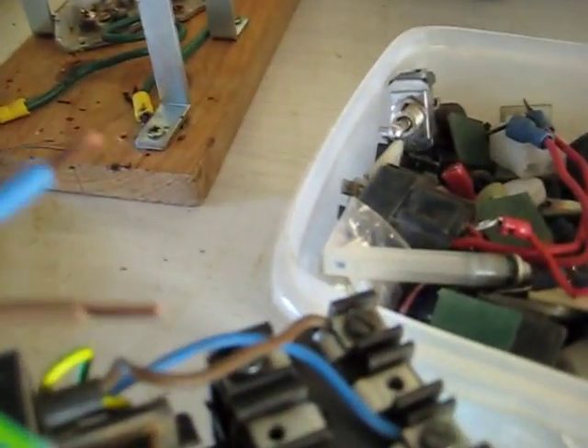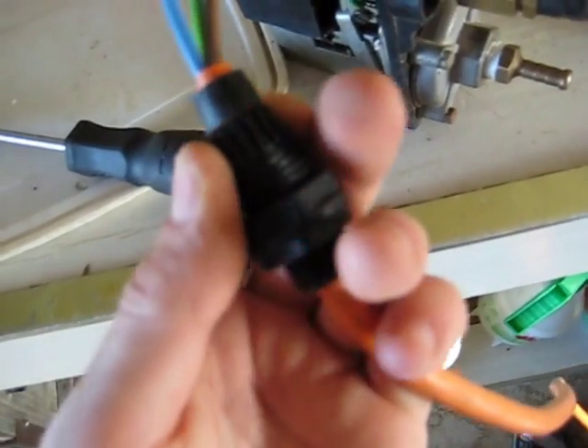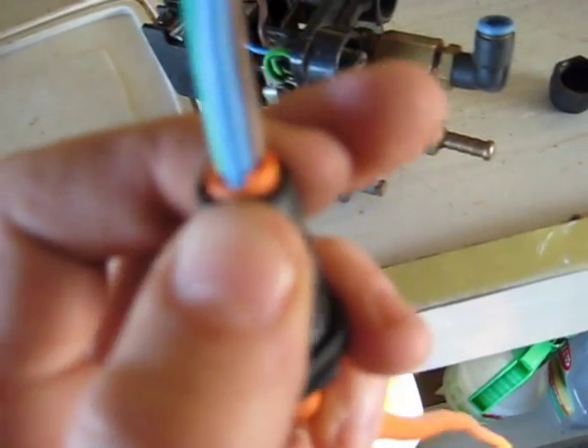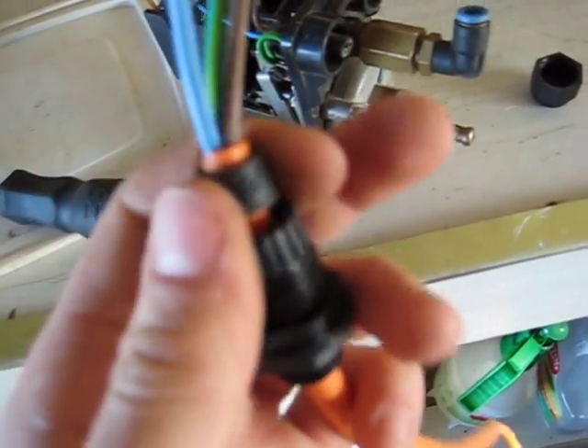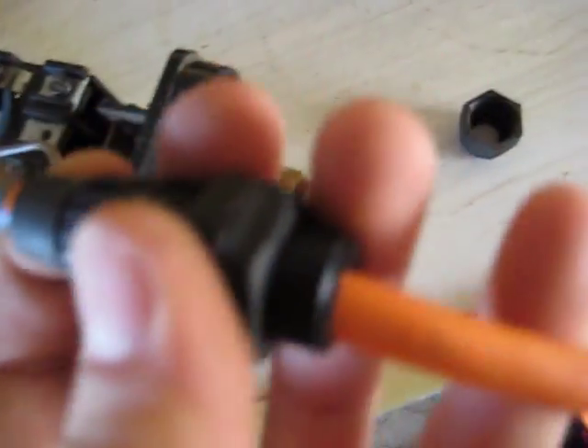There you go - you can twist those strands away, twist them, insert it through here. Push the plastic clamp on, then the grommet. That grommet fits inside here. When this closes inside a taper, it bites on and just shrinks around the cord - it forms a watertight seal. That's not quite the right thread but it does fit in there, so I could screw them in. Hopefully they'll stay and they'll be done properly - a proper secure connection to provide mechanical strength.